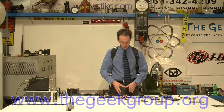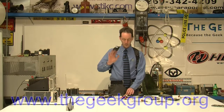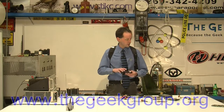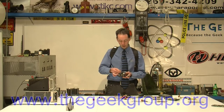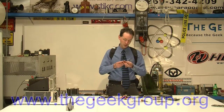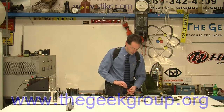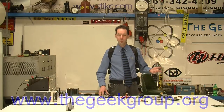If you just press one of these up against a wall, you get all kinds of low-end noise. Because this works — you're vibrating the voice coil. It works just like a regular speaker does, except it's twisting instead of pushing in and out. It's hacking a hard drive. We've done it to three different drives here today just playing around. Every single drive worked just fine, with different connection methods on different ones. On one I cut the cable down to just the two contacts I needed. On another I had to butcher into it and separate out the second and third wires. On the header one, it was the sixth pair of pins down from the end. So it's all over the place, but not a single one took me more than five minutes to figure out.